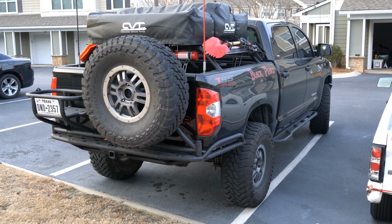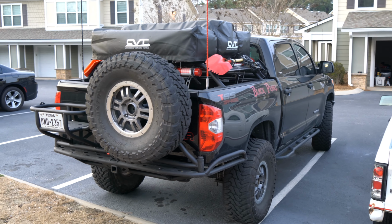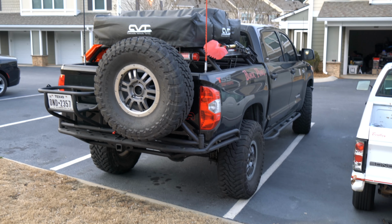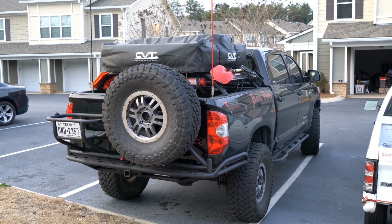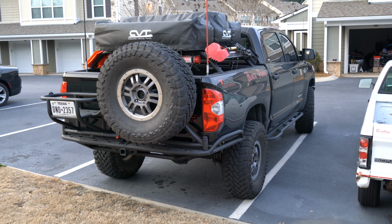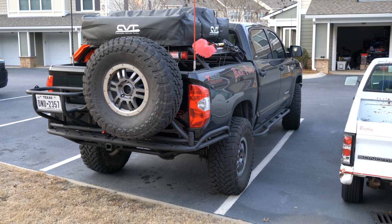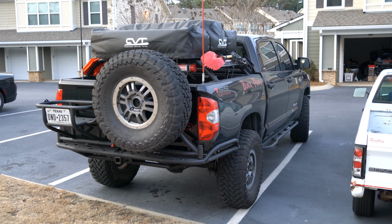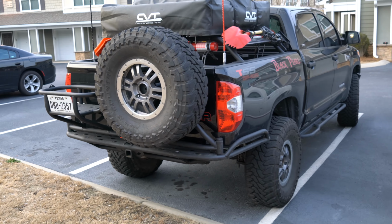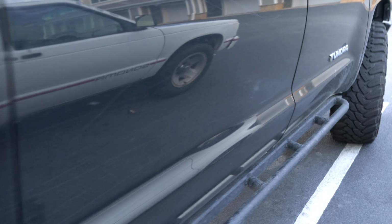It drooped a lot. I got some measurements, and it actually drooped a lot further than a lot of the cables. Even though I unbolted a lot of the brake lines and air hose lines, and the tire speed monitor wires, they were still all taut, and this thing still had droop to go. So I took some measurements of that droop to give to Boss 4x4 so they can send them to King, so they can begin building my rear King reservoirs.